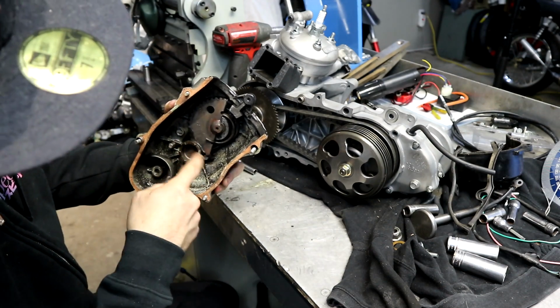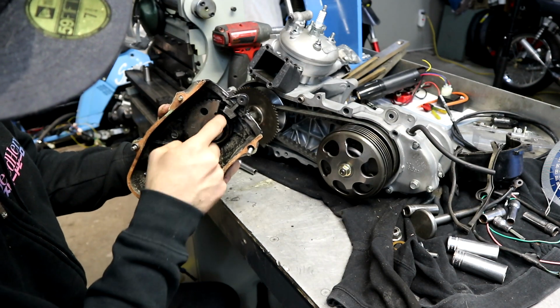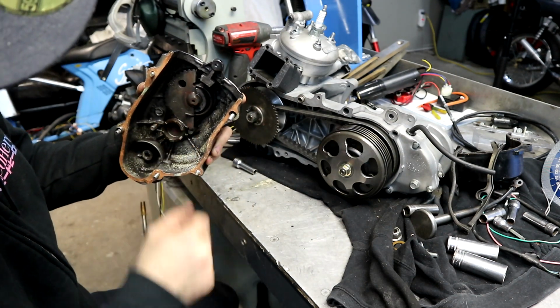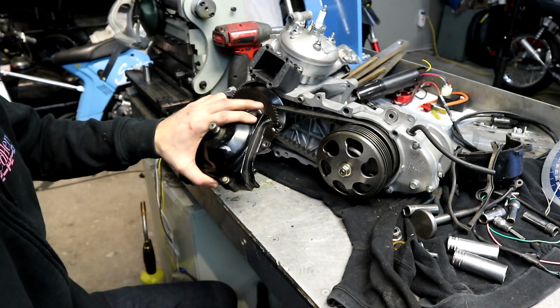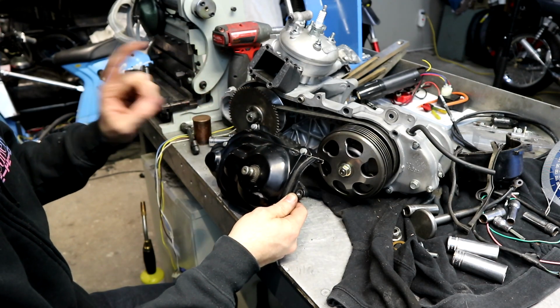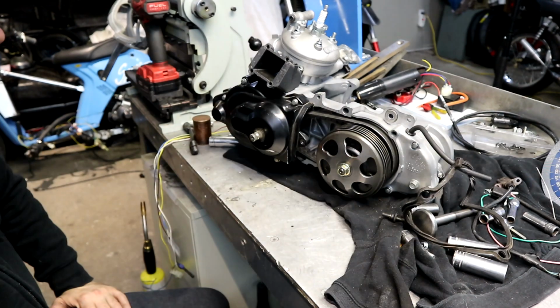It can't hurt to quickly take this stuff out, re-grease your kicker cup, re-grease the boss here. These bosses will break most of the time. It's because one of these two components sees load, and then it'll actually break the cases on the front here. Also, not running all of the bolts. It's really important to run all of the bolts for these on the front half especially. It will keep you from breaking this case piece in half.